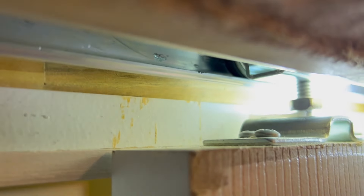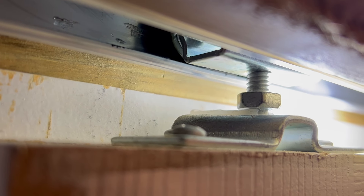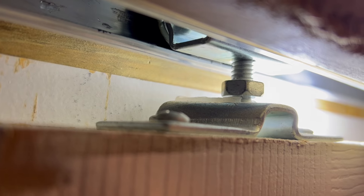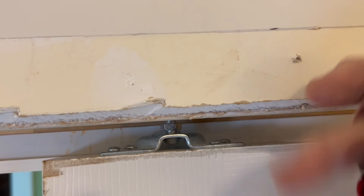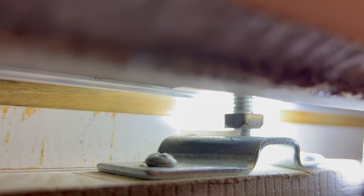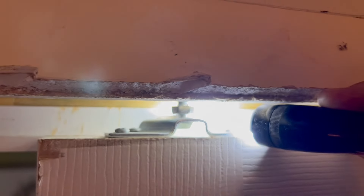Here's how this particular hardware works. Look very carefully at that nut — you see there's a nylon white plastic clip to the left of it and underneath it that prevents it from slipping off. But it's incorrectly installed; that should be under the bracket, not on top of it. That may have been why the other one failed and it's rubbing on the floor. So when we put these back on, we're going to put them on correctly.